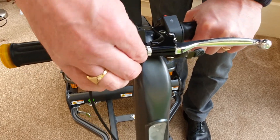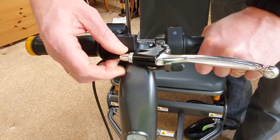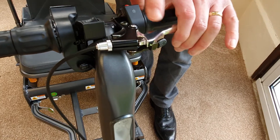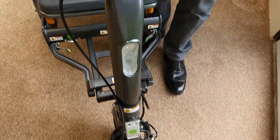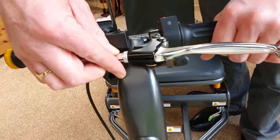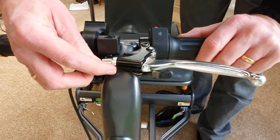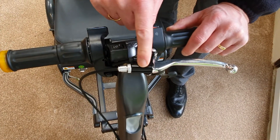This here is the adjuster — very simple. All you do is twist this bit away from the handlebar, and that tightens the brake up. When you get your eFoldie it will be in its new position with no gap between the sealing nut and the adjuster. If you find the front grip brake isn't gripping enough because the cable has stretched ever so slightly, it's always easier to adjust the brake cable when the brake is in its released position. Simply twist this away from you, which slowly tightens up the brake until you get it in the position that you like.